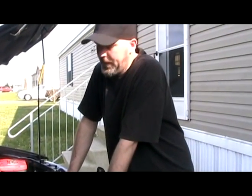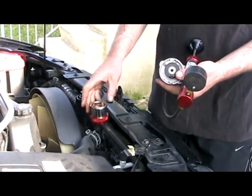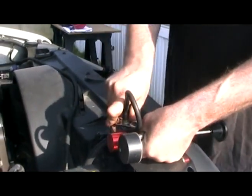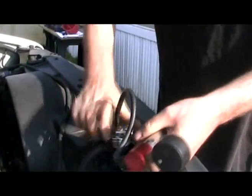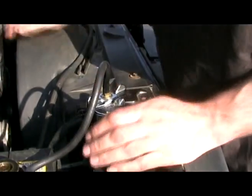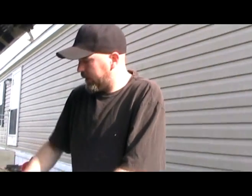On that pickup over there, I put the water pump on. Once that water pump is on, I stop, fill up the system, and put pressure on it before I put everything back together. If you have multiple vehicles, you're going to need different sized caps — this one is for the Trailblazer, and for the pickup the tool itself screws right on. So I put a water pump on, fill up the system, and pressurize it right away, because if you pinched a gasket or something, you're going to know before you put all the crap back together.